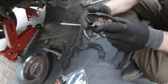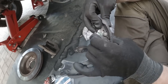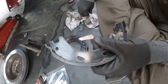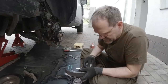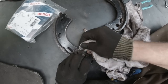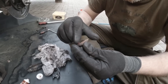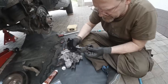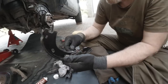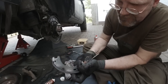See, as soon as I open the screw, this wedge jumps out, and that's really important that this wedge is in here and it's all the way over. And you can see how I got copper grease underneath this little wedge piece. We're gonna clean this and refresh this with copper grease. For setting the brake later on when it's in the vehicle, this needs to move really easy. Some copper grease on here goes back in place here. Now tightening this little screw up. That's the screw I can access later on from the outside. And when I now got this thing installed in the vehicle and I'm at that position, all I got to do is open this screw and look what happens to the wedge then. It jumps forward. Okay.